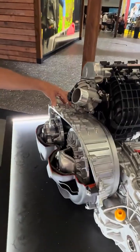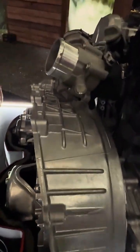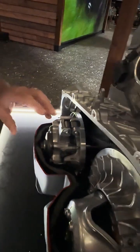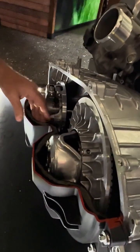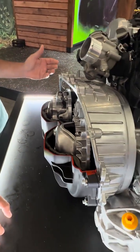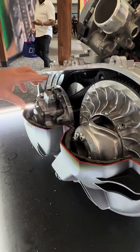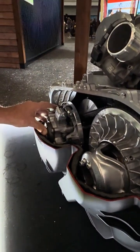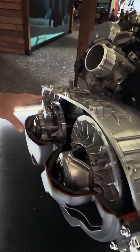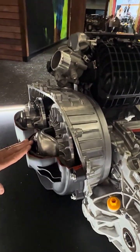You can see it's got a fully enclosed sealed belt box. On the X3 people worry about busting belts, but this is not going to be an issue on one of these anyways. It went with a P drive — updated clutch, a lot quieter, smoother operation — and they went so far as to add insulation to the clutch cover, trying to keep these things as quiet as can be. Everything's sealed up. The P drive clutch setup is specific to every model — a cab model will be a little smoother engaging than an XMR because they've all got their own setup in the weights and rollers. Secondaries are standard, basically across the board what was there, no big updates there.